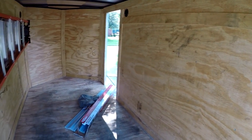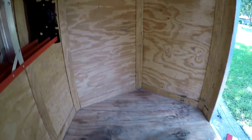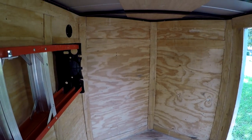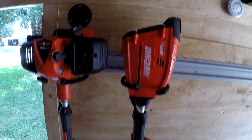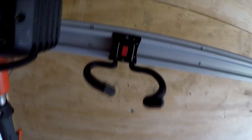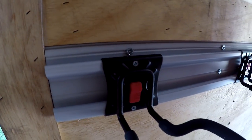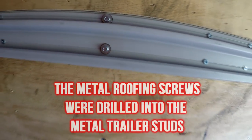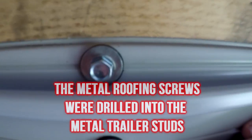Now we're starting to look a little bit cleaner. I blew the trailer out and removed all the hooks that were in there, so we're starting back at a blank slate. I just used some wood screws at regular intervals to install this tracking. I also used some very tiny screws to secure the hooks into the railing, so the railing is secured to the trailer and the hooks are secured to the railing. I came back and added some metal roofing screws that have these nice little rubber washers on them for some extra stability.